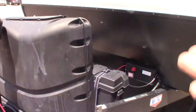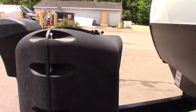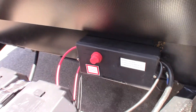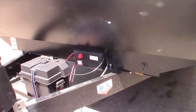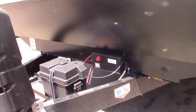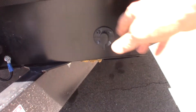You've got two LP tanks that are full with an automatic changeover regulator. Deep cycle marine battery, and this is the kill switch for the battery. Right now it's on, which is the way you want to keep it unless you're in storage. You always keep it on so your power converter will charge the battery, and when you're towing it your tow vehicle will charge it. This is also a hookup in case you want to get a solar panel to charge the battery.